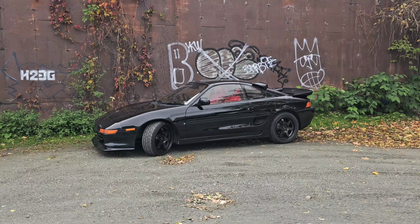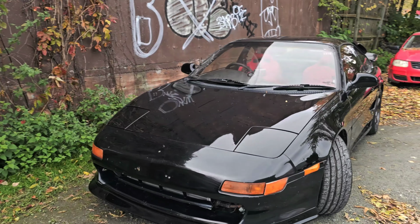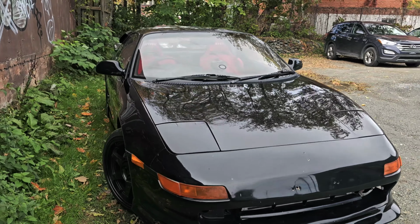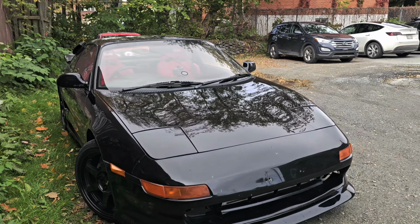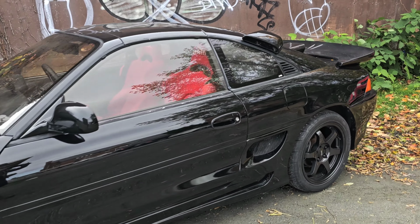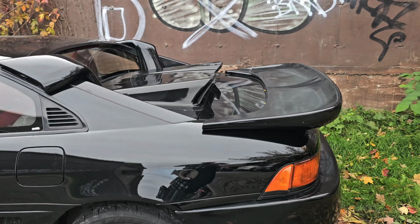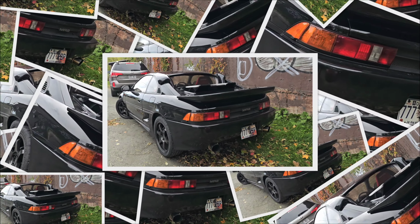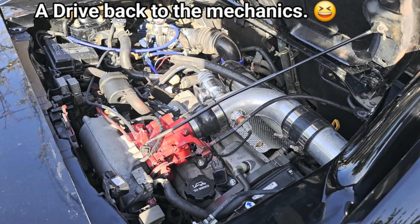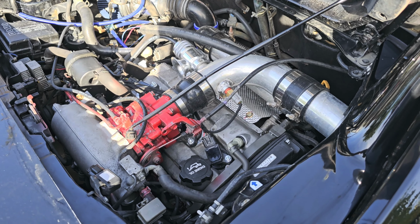All right, so maybe you already guessed it, but this is back to the mechanics. We have a lot of modifications in this vehicle. You can see the upgraded intercooler in the front here to help it from not overheating. But it is getting really close to overheating. It's on the final line before being that overheat, gonna blow that engine. So even though we've got all these air intakes on the vehicle and also the air extractor, this is overheating, so off we go, folks. Now, right before we take this for a drive, let's mention that yes, currently the battery light does come on. I either have an issue with the battery or probably the alternator is due, and this is the third engine.